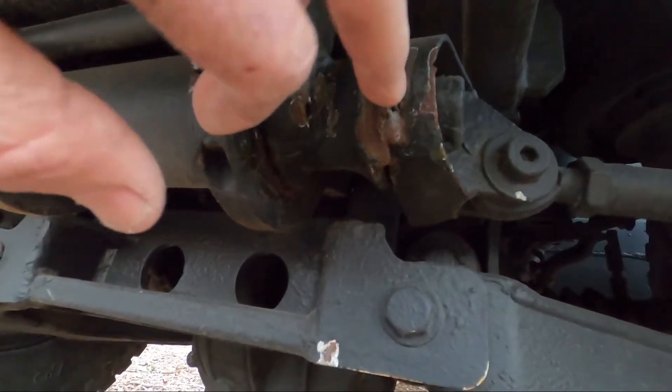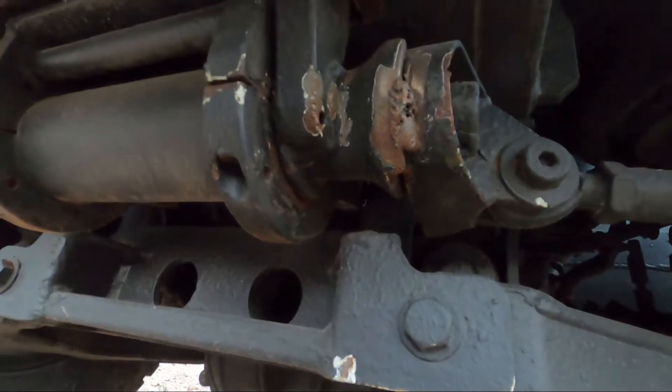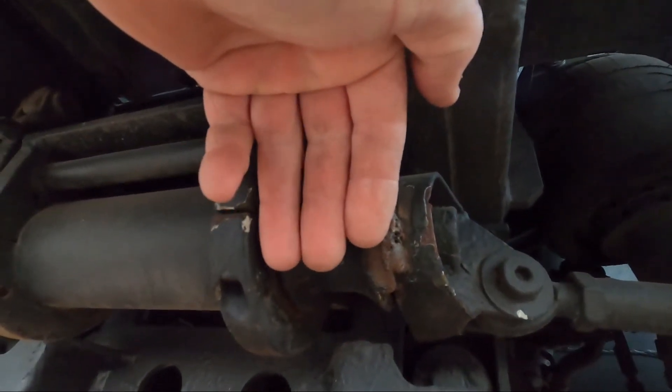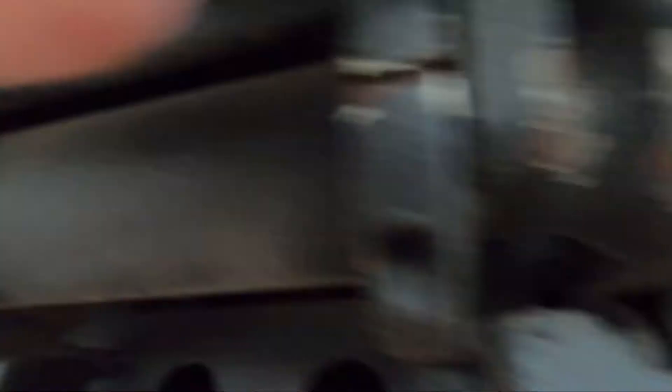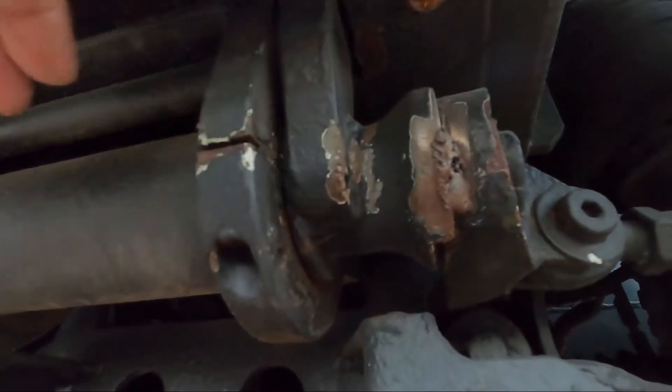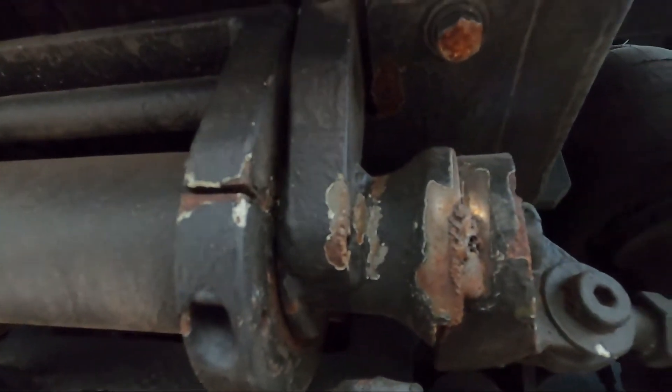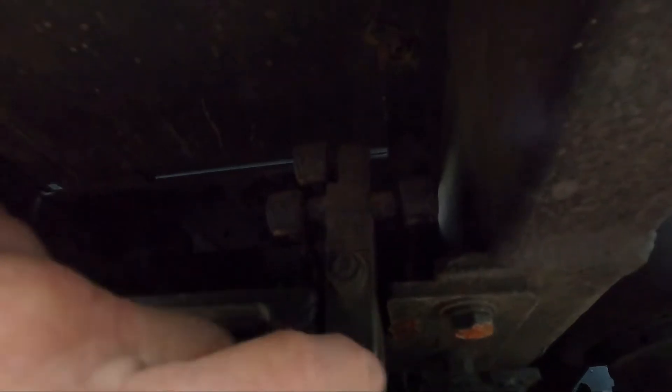Here's where they weld them. If you decide to grind that weld off so the steering locks can release, you'll want to fix these because on every Growler I've worked on, these have been bad. Once you grind that off, it allows the rear steering to function — it has an air ram right up here that uses compressed air. You have to have air built up in your system, put it in reverse or first, turn the system on, and then the ram will retract with compressed air and lift these two locks up so the steering can slide side to side. When you shut it off or take it out of first or reverse gear, it releases the air and these two gas pressure rams — 60 pounds each, so 120 pounds of force — pull it back down to lock the rear steering.